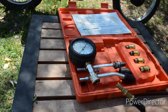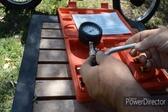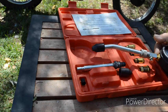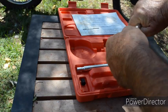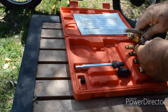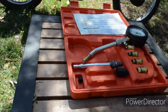So what can you do to improve the accuracy of this test kit? Well, if you use the steel tube onto the gauge and then press this against the spark plug hole, I've found that gives a much more accurate result. I think the reason for that is firstly there's not as much volume in there, but also this tube has a schrader valve in there, whereas the flexible hose has a ball check valve — not a schrader valve — and so it doesn't seal off as quickly.